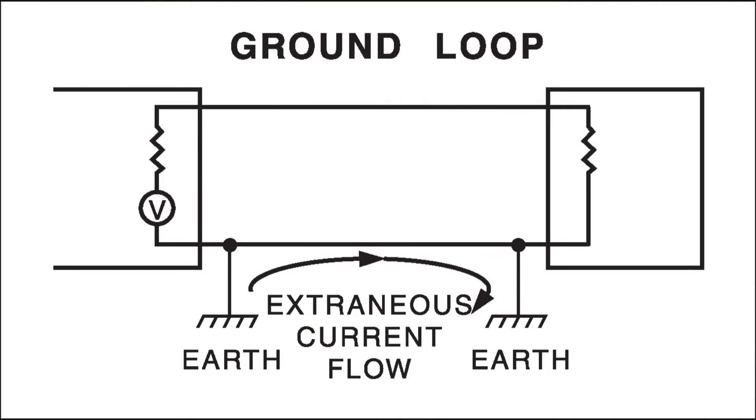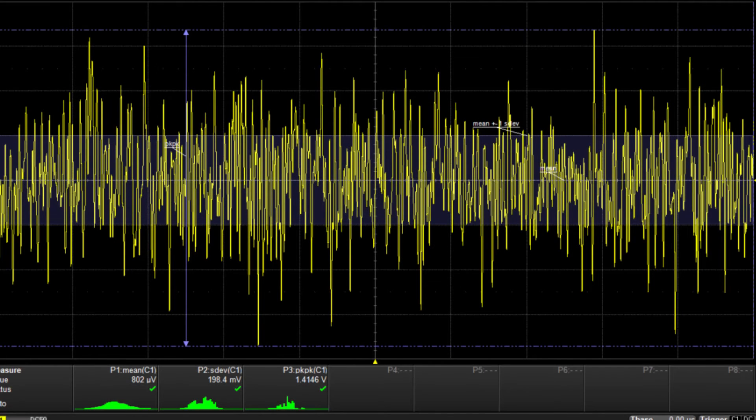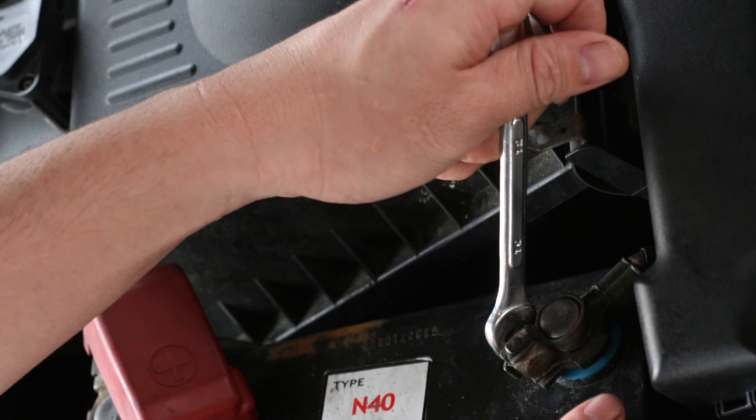One major point to remember: DC connectivity is not the same as RF connectivity. When you improperly bond or wire your installation, it's possible to create a ground loop with the vehicle's superstructure. When you create a ground loop, the resulting effect will often appear to be RFI. This is the reason ground loops are the toughest problems to find and correct. Thus, under no circumstances should the body and/or frame be used as a path for DC ground return. Doing so on a modern vehicle is a prescription for RFI and operational problems with various onboard electronics.